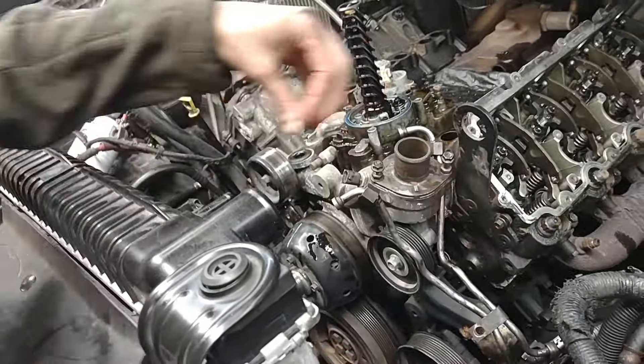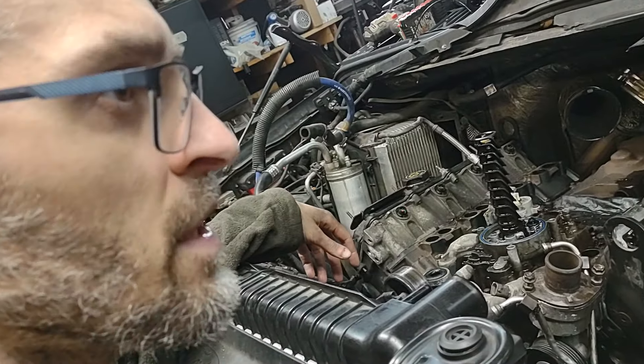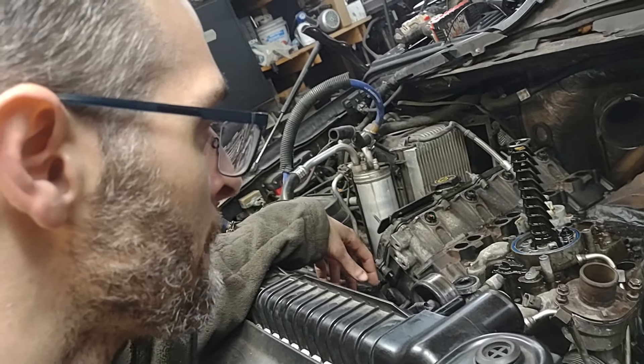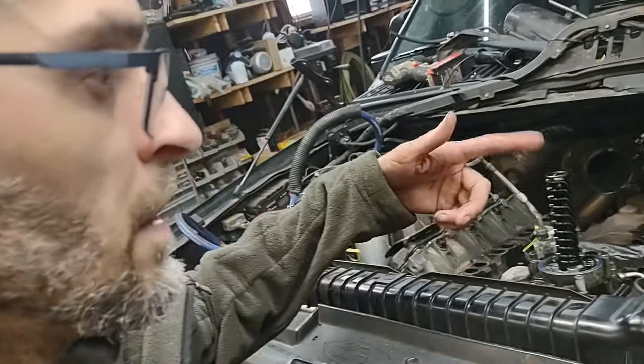Even though it's studded, I've got 240-something miles on it. I did all the testing — did the pressure cap tester, got the combustion leak checker. Every test I did basically pointed to head gaskets, no matter what I did.